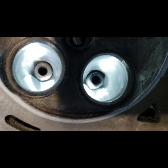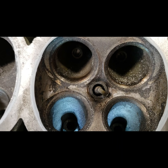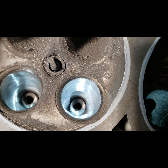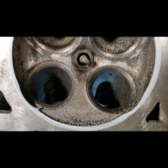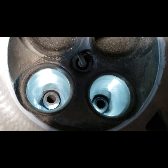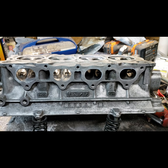Here's a view from the top — stock versus ported. The ported one is just a rounder shape, more cleared out. The stock one is kind of abrupt — it goes right in and hits that valve, which stops the airflow. The ported one allows air to nicely and smoothly go out and around it. On the exhaust side you want it as straight as possible to spool the turbo and get a nice pulse going down through the exhaust for good quality flow. That's two done on the exhaust side, two more to go, and then I'll move on to the intake.